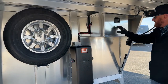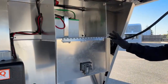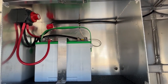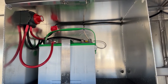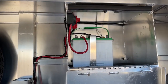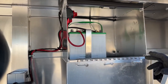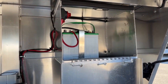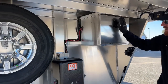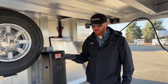With the equalizer setup, you get a battery box — made at the factory — with a battery to run the jack and a battery disconnect switch. That cutoff switch became standard around 2022. If you accidentally leave a tack light on, it would drain the battery, but now you simply turn that switch to the off position and it kills all power to the trailer. The battery box also has a door latch keyed the same as all other doors on the trailer.